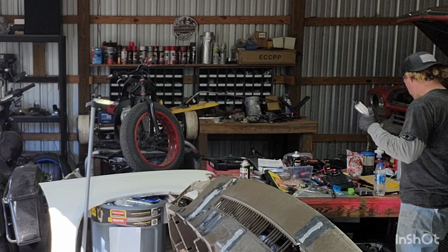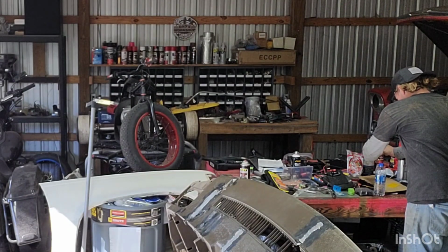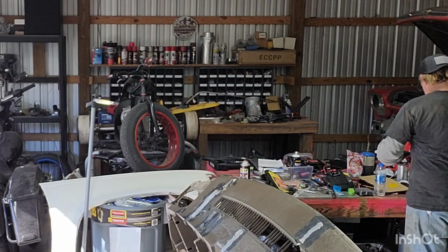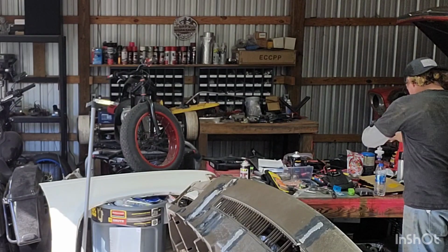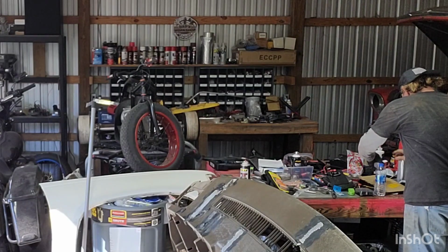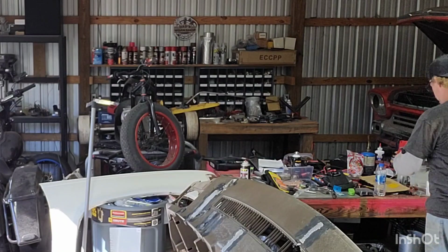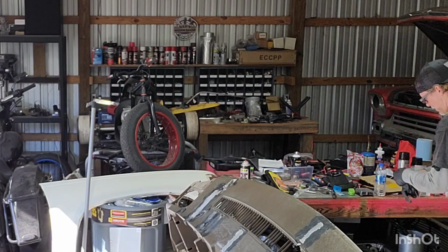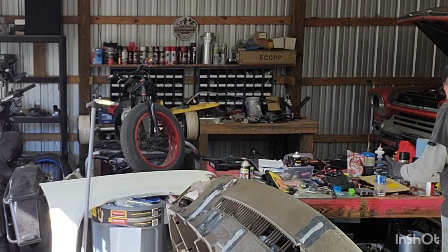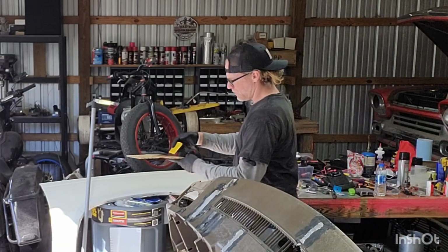I'll go ahead and put it on some of this cardboard here. Nice, good, healthy amount. Our dash pad or cap is sitting out in the sun right now, warming up. Like I said, we're going to pull it in here and set it on top of some of this epoxy. Make sure you wear gloves too, because this stuff is a pain to get off. I had to use acetone yesterday to get it off my fingers.